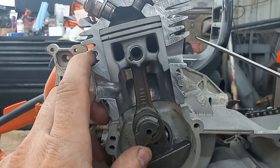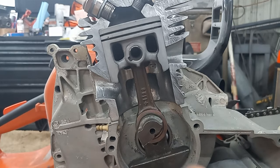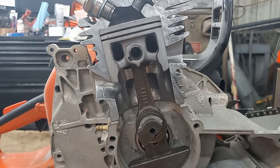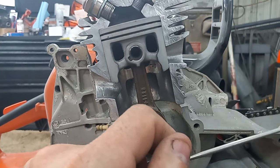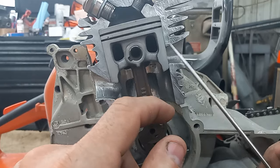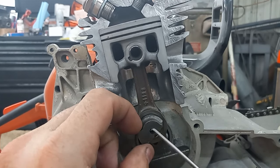With a combination of freer-flowing exhaust, I typically run longer blowdown than most do. I'm not saying I'm right or wrong — I have no idea. I can only tell you guys what I have tried, what I've experienced, what saws have done when I've manipulated blowdown — these are my own accounts. Just like I run — more and more people are running closer timing numbers to what I do. I've run 102 for a long time and used to get a lot of grief for saying to run a 102 exhaust roof on a work saw. I love a 102 exhaust roof on most builds.